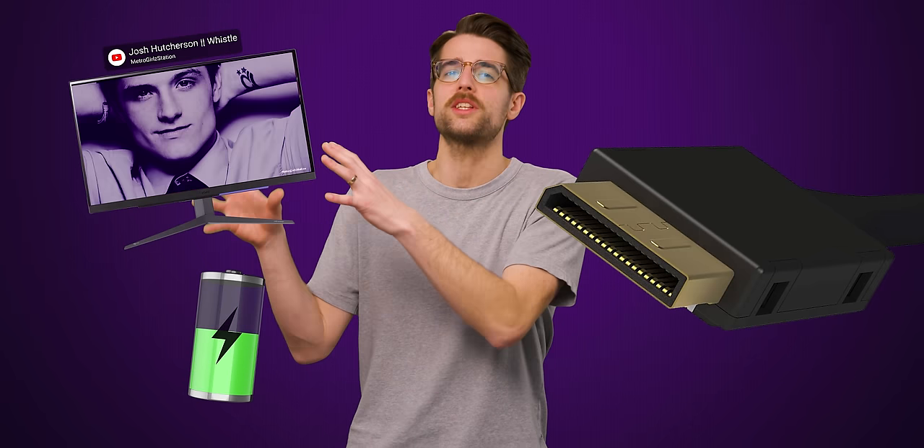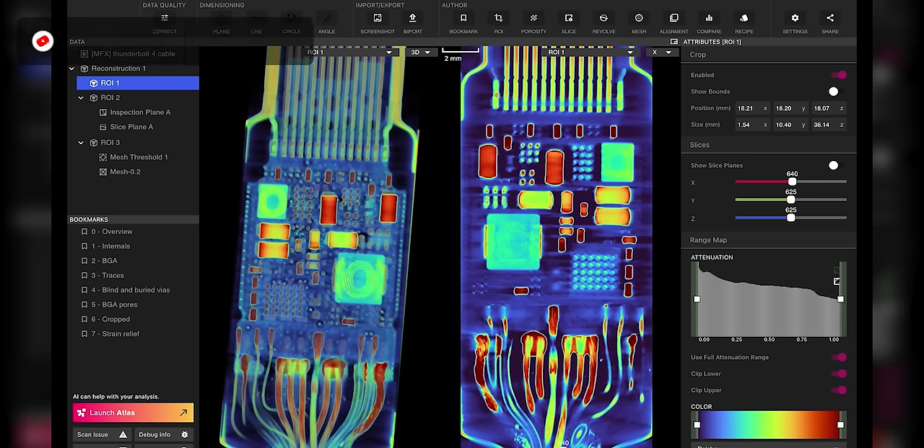You could, hypothetically, create a version of Oculink with some or all of the bells and whistles that Thunderbolt offers, but that might be missing out on what makes Oculink truly great. Thunderbolt is designed to be a generalist connector — a jack of all jacks — made to do several different things quite well, wrapped up in a convenient, user-friendly package. But generalization comes at the expense of specialization, and lower data transfer speeds and throttling are a result of that compromise. A similarly flexible and multipurpose Oculink connector would also probably be far more expensive, because when you're combining a bunch of complex components exchanging a bunch of different signals in a very small space, that demands both creative engineering and extremely precise manufacturing — otherwise there's going to be interference between these different signals, and it won't be reliable.